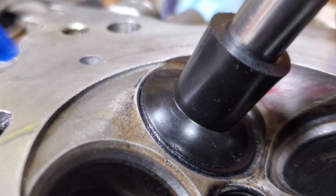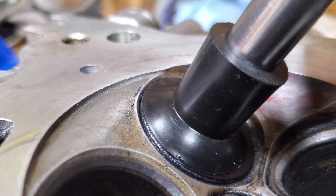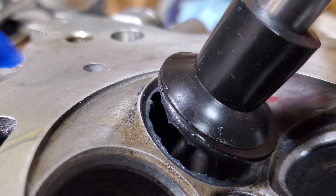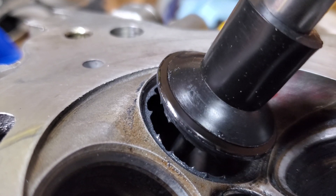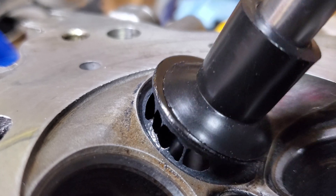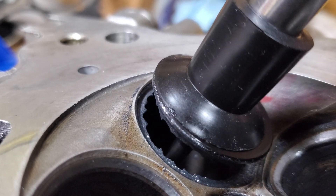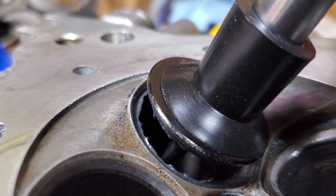As we're doing this, we want to make sure that we're pulling the valve out — and you can see what that's doing. All that's doing is making sure that it's getting clean fresh valve compound each time, and it's going to make sure that you don't have two or three deep grooves. It'll be the equivalent of using a finer sandpaper and it'll give you a more uniform grind. So that's what's needed for a good seal.